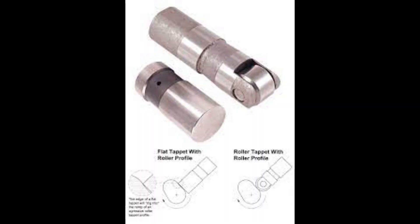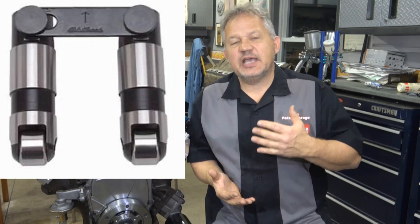To understand that, let's talk about the two different kinds of cam: your roller and your flat tappet. When you're choosing your cam at the beginning of your project you have to think long term, specifically break-in. Roller doesn't have to be broken in; flat tappet has to be broken in. The reason for that is all in the geometry of the camshaft and the lifters. First, let me dispel a myth: a roller cam is not going to give you more horsepower. Because a roller cam has a roller on the bottom, it just has less resistance to turn or move than a flat tappet, so it doesn't add horsepower — it just takes away less when it's operating.